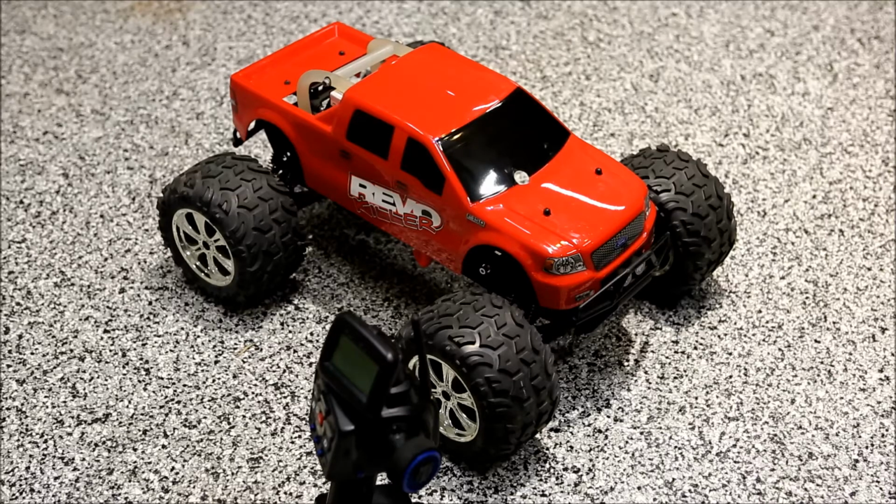The throttle body, I had it ported, and it's infused on the contact points in the throttle body with KY jelly, as funny as that may sound. But it gives you like a really, really smooth throttle response. So you don't get the strong lurches forward, backwards when easing into the throttle, which is a pretty big deal on a truck that's got this much power in it.